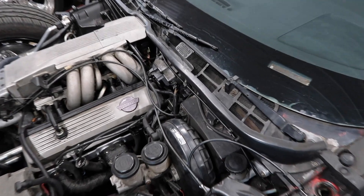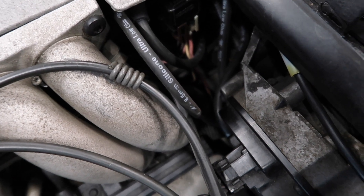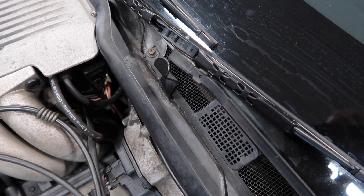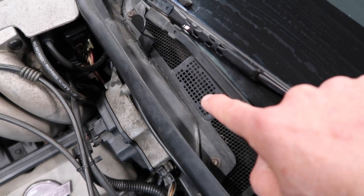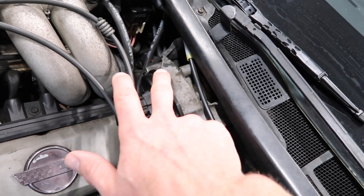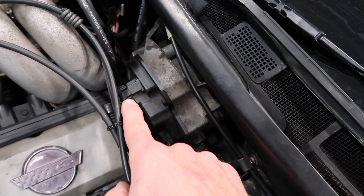Under the hood on the driver's side, that's the wiper motor, and down in there is the oil sensor. This grill here on the wiper cowl has four Torx 15 screws. We're going to take this off to access the nut holding the motor to the linkage. Then we'll be able to take the three 10 millimeter bolts off the motor. There are two connectors, one here and one there.